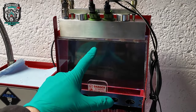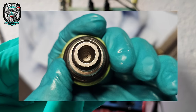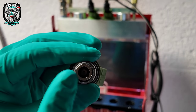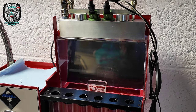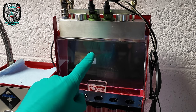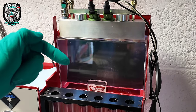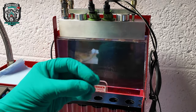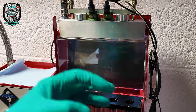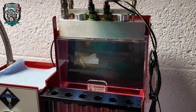These are single hole injectors - there's one orifice for the fuel to come out of. There are loads of different designs: two holes, four holes, even six holes for different spray patterns. The issue I have - and I'll show you on the bike in a minute - is the angle these injectors fit into the throttle body means the fuel is literally getting sprayed onto the inside of the inlet manifold. With a cold engine, you're just wetting the inside of the inlet manifold and hardly any fuel is making it into the combustion chamber atomized, which is why cold starts are such an issue.